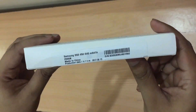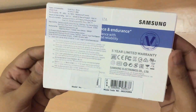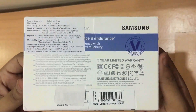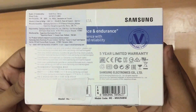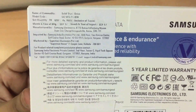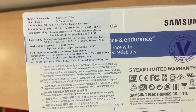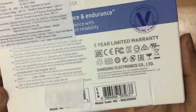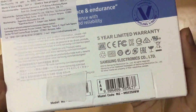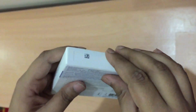Installing this mSATA SSD in old laptops is a bit difficult because laptops were not designed to boot from mSATA SSDs — only the primary hard disk is searched for bootable records. It will work fine if you have only the mSATA SSD in your laptop, but if you put the hard disk back, the laptop will not boot from the mSATA SSD. This is kind of bad news because we don't want to ditch those hard disks owing to their large storage at a cheap price.